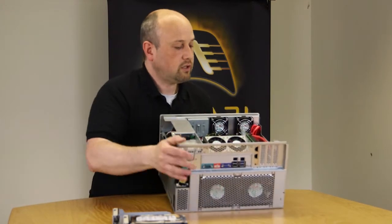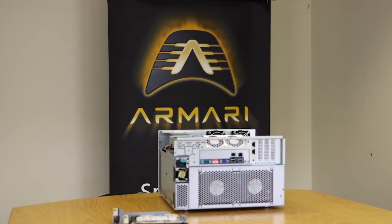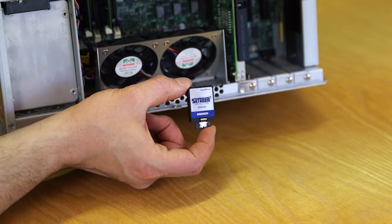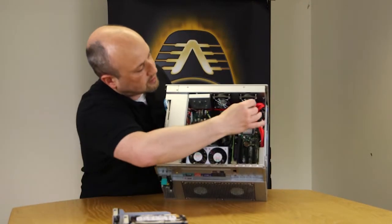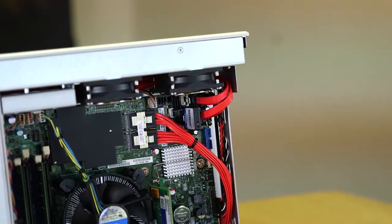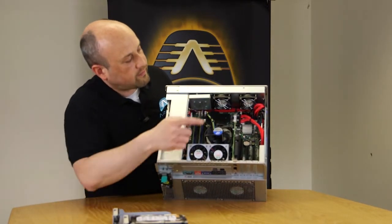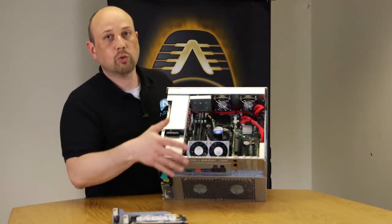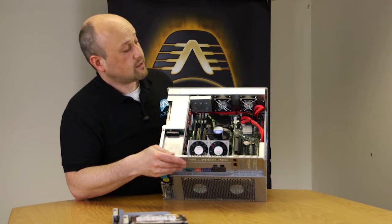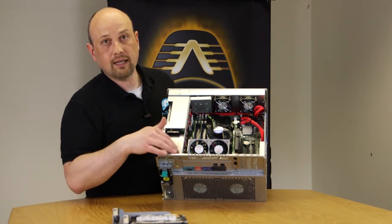If 12 bays isn't enough, there's also a small SATA DOM that clips onto the motherboard, powered via a special cable from the USB port, allowing the operating system to run from the SATA DOM. That's a 4GB SATA DOM. This frees up all 12 bays — for example, 10 hard drives and 2 SSD cache bays.